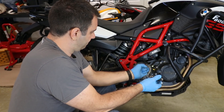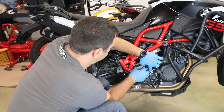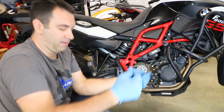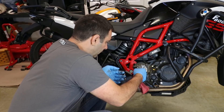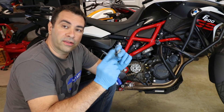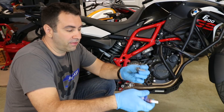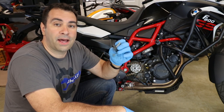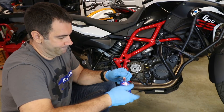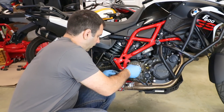To put it on, move the chain aside, seat the sprocket, put the chain on the sprocket, and clean up the excess grease. When you're ready to install the bolt, remember the concave part of the washer goes towards the inside so the edges are in contact with the sprocket itself. BMW calls for Loctite 243 threadlock, so apply some threadlock and put it on.